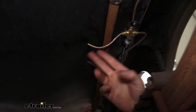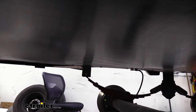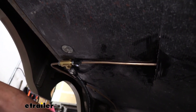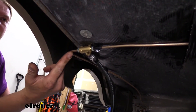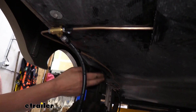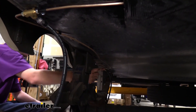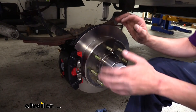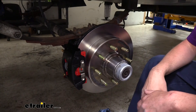The line that's longer than the two short ones — the medium sized line — goes across from one side to the other. I made a small slit in the panel and ran it over, then made a slit on the other side where the line pops out. Over there we connect to a three-way fitting. We again come off the back with a flex hose going to the caliper, just like we did on the other side. And just like the other side, when we come out the outside we bend it back, go on the inside of our equalizer, continue on back, make a loop to get rid of the excess, connect to a union, and it's the same as the other side for the rear axle. In addition to your line kit, you are going to need a disc brake system — we've got calipers and disc brake kits available at eTrailer.com.